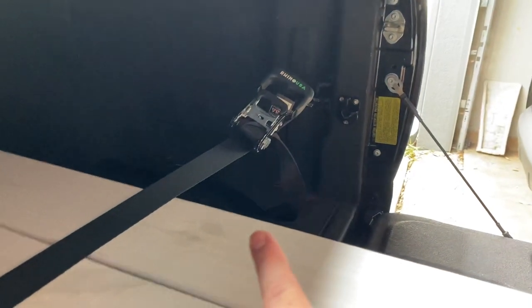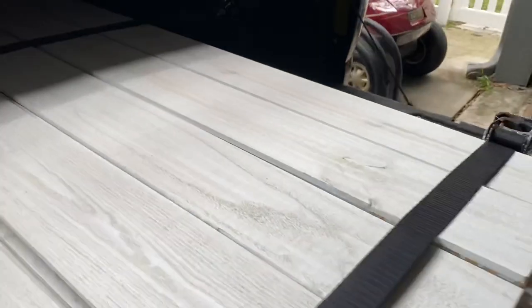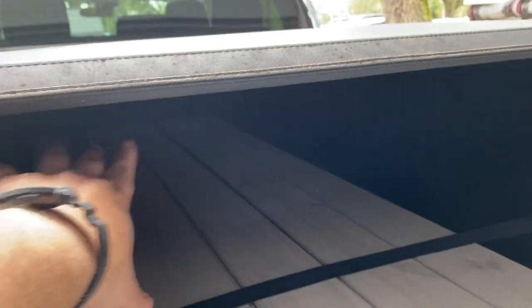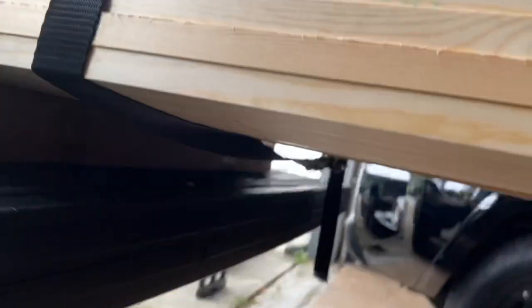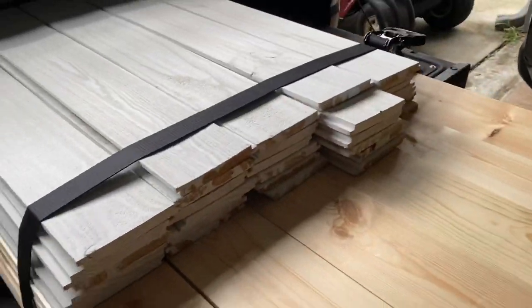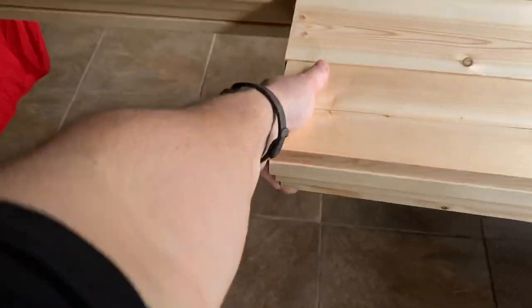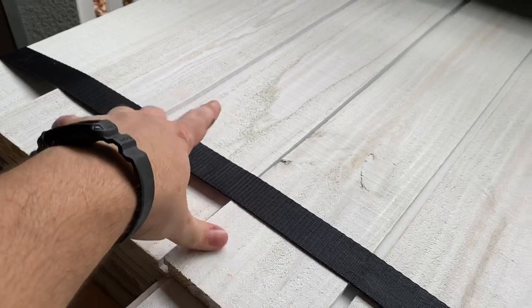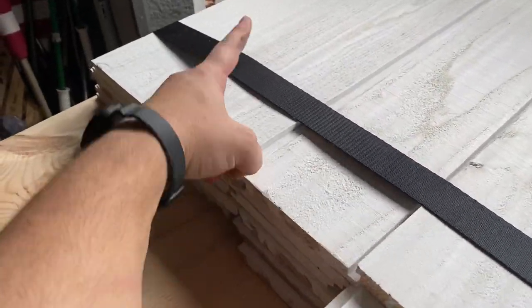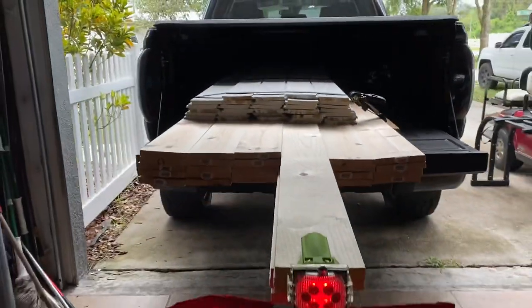The way I do it is I attach it to the built-in bed hooks on each side, which you can't really see up front, and it cinches it down. Then for good measure I'll run another strap in the back to cinch it down. This loads pretty evenly centered on this pinch point. Then instead of just stopping there, I actually wrap the wood all the way around and pinch it again together, so I bundle it right here with the strap. This locks it all together — when I'm shaking it back and forth, none of that is going anywhere. If the highest point of the wood is in the center, it'll pinch it better versus having high sides and a low center where stuff will slide right out.